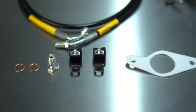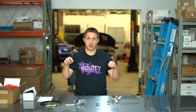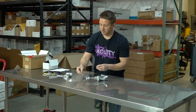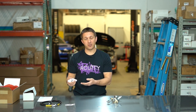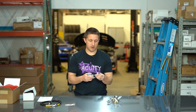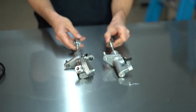The kit comes with everything you need to hook it up to the master. These brackets replace the factory ones — the factory line connects hard line to rubber line to hard line through a couple brackets right underneath the intake, and these replace those to hold the line nice and secure. The pedal bracket you just screw on, and it's just as adjustable as the factory master cylinder and clutch pedal assembly. You can adjust where the pedal sits and how long you like the throw.